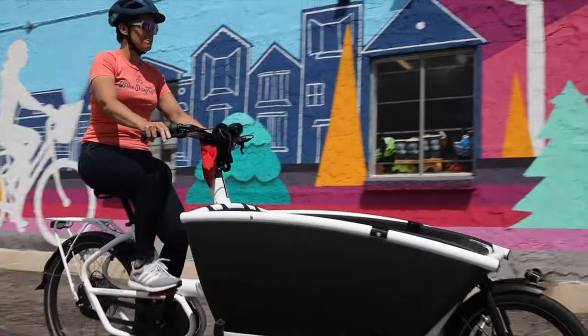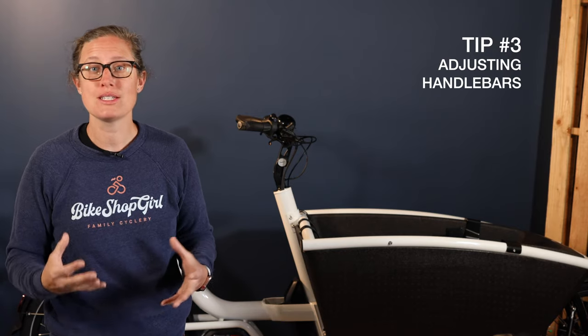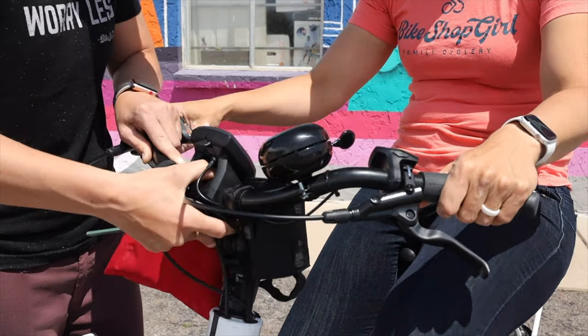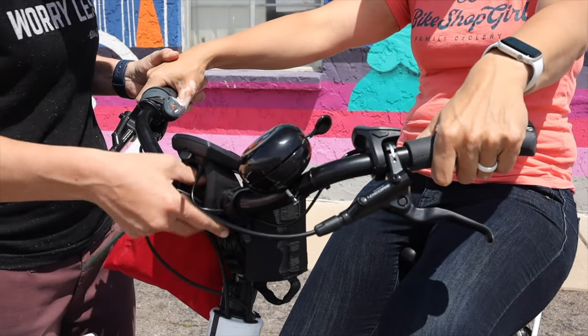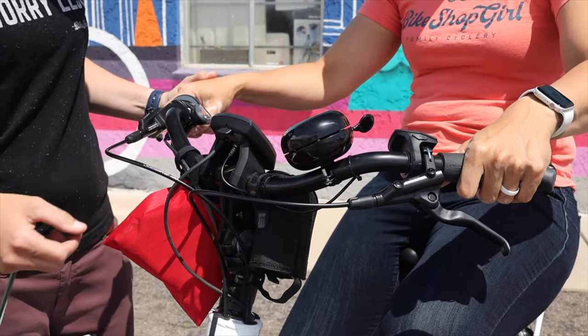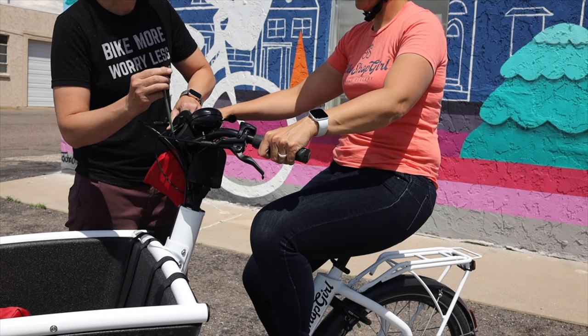In the future I will be doing a video dedicated to riding and steering box bikes, so make sure to ask any questions about that below. The third tip is adjusting your handlebars so you feel comfortable and confident. Using a simple one-bolt design you can raise and lower your handlebar and also adjust the tilt. Doing this with a friend is the easiest so you can keep your hands on the handlebars. Adjust the handlebars so your arms are comfortably reaching out — not too high so your shoulders are wearing out, and not so low that your weight is on your hands.